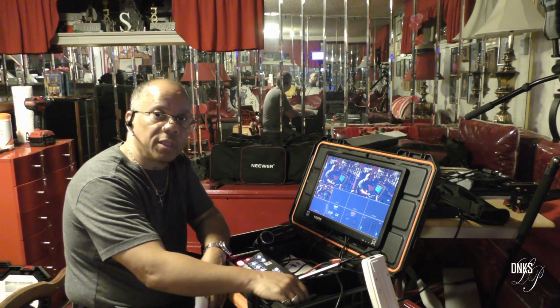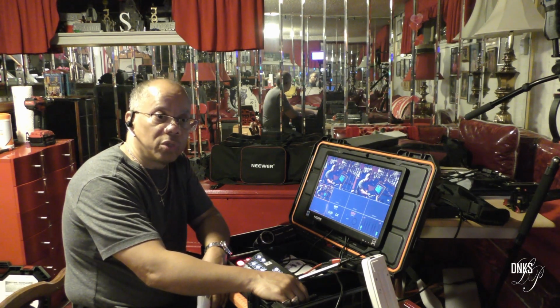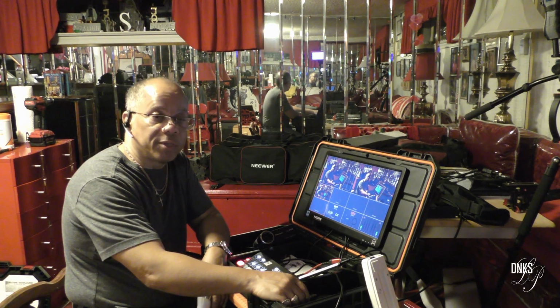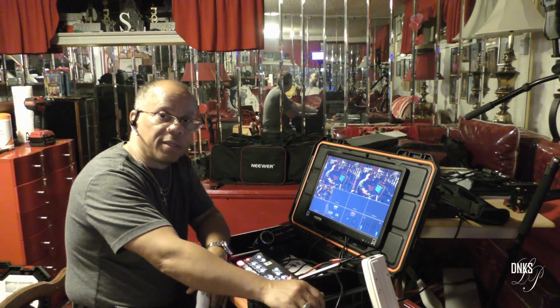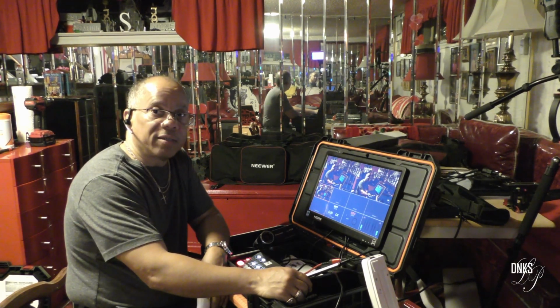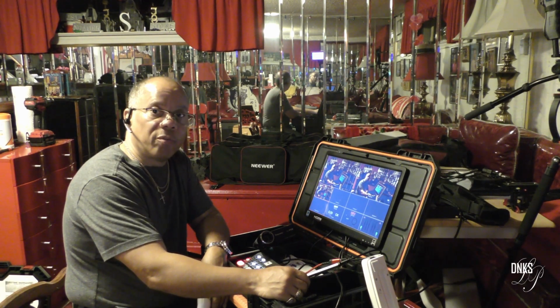don't work. It has more to do with the formatting of the drive than the speed, because the first drive that I got to work with this was an old USB 2 drive. It was a 64 gig USB 2 Corsair thumb drive, and it worked fine, no dropped frames or anything like that. It wasn't even USB 3, let alone SATA, M.2, or any other specs that would make you believe it had the speed to take the recording. But it works fine. So it's more the file format than any of those other performance standards for these drives.